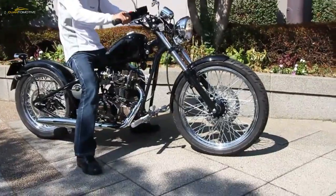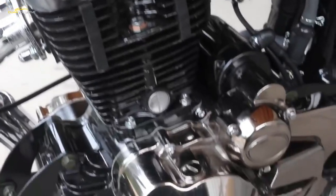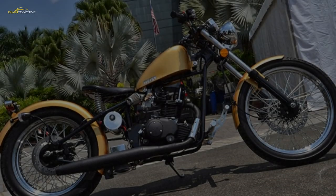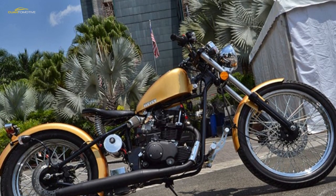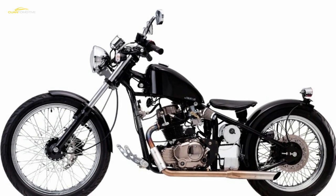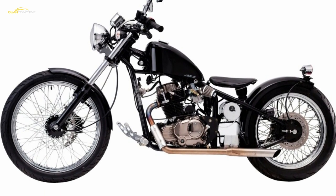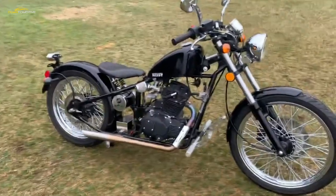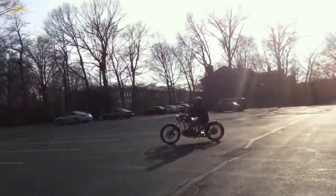The company was originated by Honda as a supplier of engines and engine parts, building many complete series under license. The 250cc engine in the Heist is not an off-the-shelf model — based on the CG series layout, this version is counterbalanced and has redesigned intake and exhaust tracks, specifically engineered to easily meet strict EPA, CARB, and EEC standards. The counterbalanced internals are accompanied by a performance-enhancing cam curve and closely machined tolerances. The design criteria of simplicity, weight, longevity, reliability, owner-oriented maintenance, and cost called for a conventional overhead valve configuration.